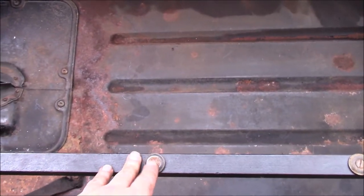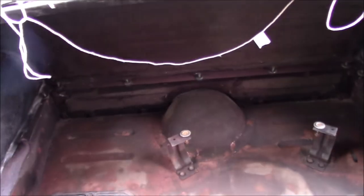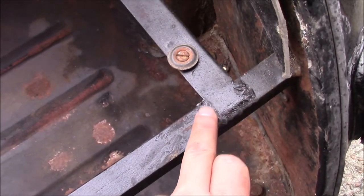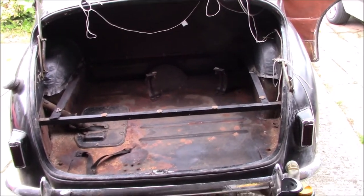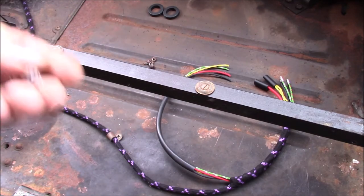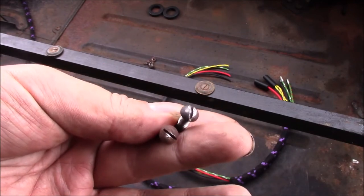I also went through and sorted out these fixings. It looks like somebody might have had this panel out before because a lot of them are in the wrong place. Once I'd got them all out I could sort them — they all had specific homes where they clearly went. This one was a bit annoying though — somebody had forced it and there's no thread left on the captive nuts, so it's now a bolt through. This is, as far as I'm aware, factory quality — this is the quality of a coach-built car; they're basically glorified kit cars. With everything cleaned as much as it needs to be, I can now put the new wiring in. The hardware has been cleaned up and they don't come up perfect but they come up good enough. I've also filed off the bad bits of the screws to get them back to a decent clean slot.